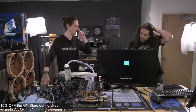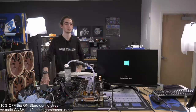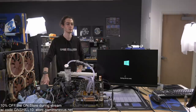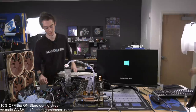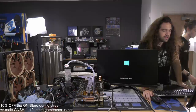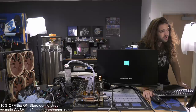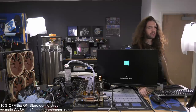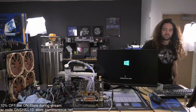Did you move the DVD drive somewhere? The external one? No, the one Michael had. Oh, I don't think so. I know where the external one is. Yeah, it was on the shelf with that one. I saw the external one. But if it's not booting from a USB device right now, that's also USB. I mean, it is booting, right? Unless it's booting off the SSD. Oh no, you're right, it is booting off the drive. You want to try unplugging the drive and see if maybe the boot order is wrong? I guess you set it to boot to removable.